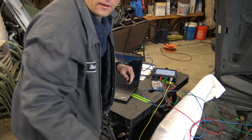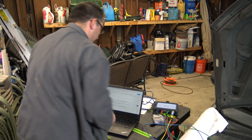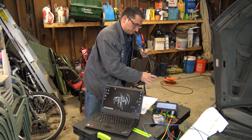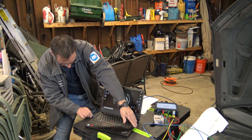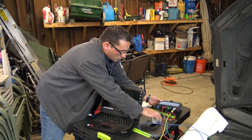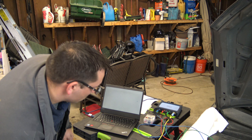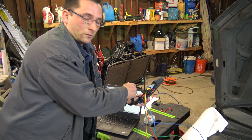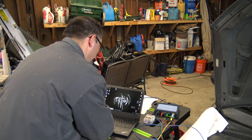I don't know other brands of scopes — I'm still learning a lot about this stuff. But with the PicoScope you definitely have to have the scope plugged in before you start the software, or else it will not recognize the device. So let's go ahead and hook up our scope. The scope will light up — there is a little tiny red light right in the corner to say that it's on. As we initialize the software, that light did go out. Once you're actually capturing, the light in the corner of the scope turns green.